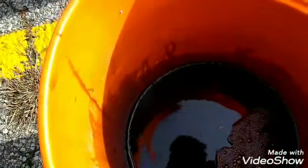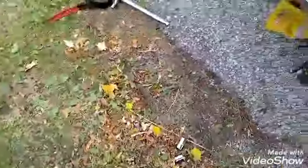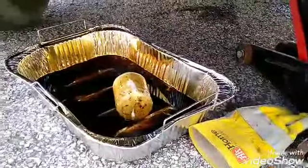No chunks of metal flakes. What I always do when I put my new filter in — I put a magnet, a fridge magnet, on my filter on the bottom — the oil filter — so it'll pick up any sharps and metals and stuff in the filter. Did the oil change and the filter.